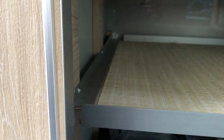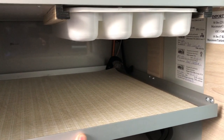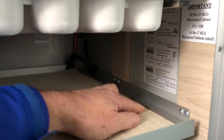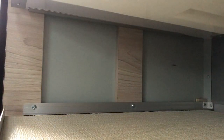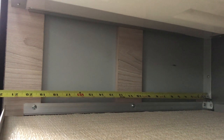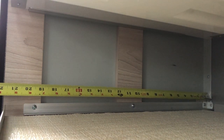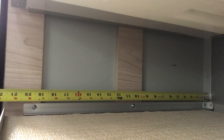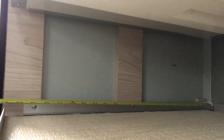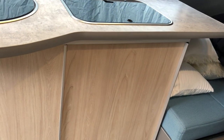We're going to replace these sliders on the side with full-motion drawer slides with soft close. That's going to entail some careful measurement and maybe some trimming. I'd also like to add a piece of aluminum around the side that will give us something to screw the drawer slides to. Measuring now — right to the back wall on top of that L-bracket to the front piece of wood, I'm calling it 21 and 3/4 inches. That's the maximum length of the drawer slide we want. We can probably do it with a 20-inch slide, giving us an actual drawer length of about 20 and 3/4 inches.